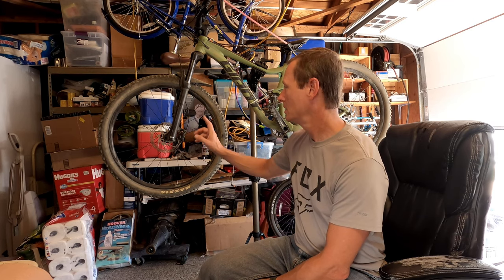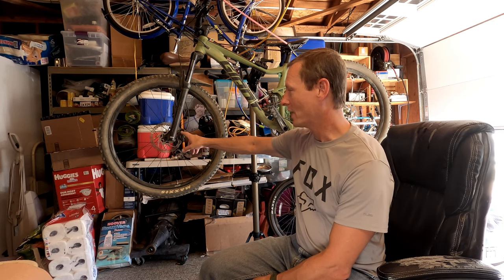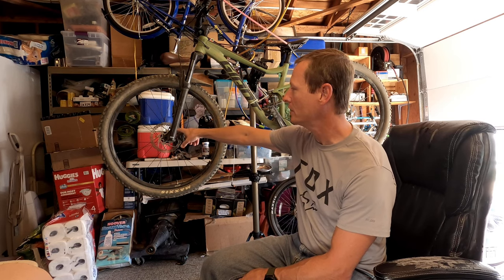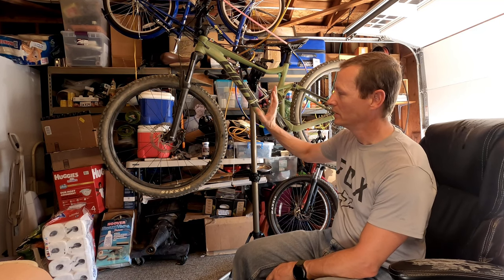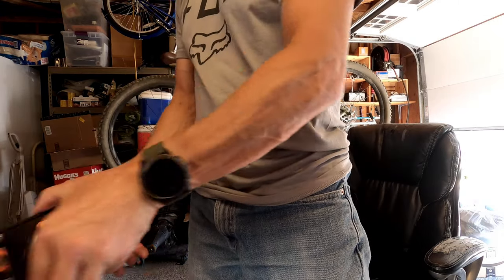So I bought a SMRT66 203 millimeter. I'm gonna put that on the front end, and if everything goes well, I think I can take the 180 millimeter front rotor and the spacing bracket and move that to the rear wheel. So I'll have 203 and 180 in the back if all my parts fit. So that's what we're gonna find out.